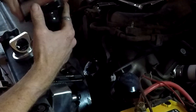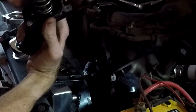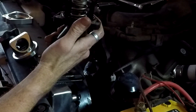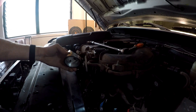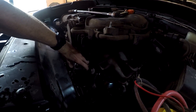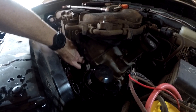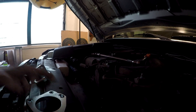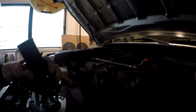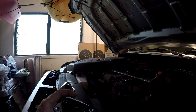Most of the coolant went into the bucket. There is a rubber ring that is also part of this — it looks like it was stuck to the engine but this rubber ring slips down in there and makes a seal. Now with the thermostat housing off and put between the studs — so now I'm going to mark the three holes I need to drill through on this in order to make it fit.